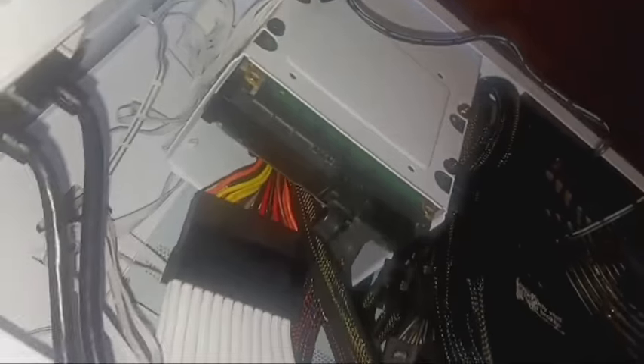I have one more fan plug up in the top left. Around the back side I've got this little fan hub, so all the fans are routed and plugging into this hub. This one black wire goes from the hub onto the fan port on the motherboard, so that one fan port powers pretty much all the fans off this little hub. I'm going to peel and stick it right there on top of the hard drive caddy and run the wire to plug into the motherboard.